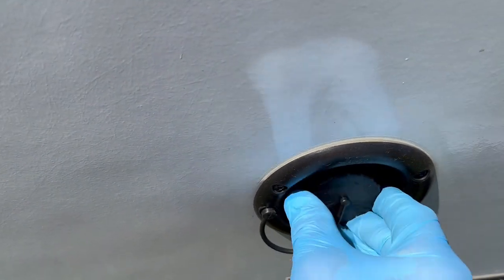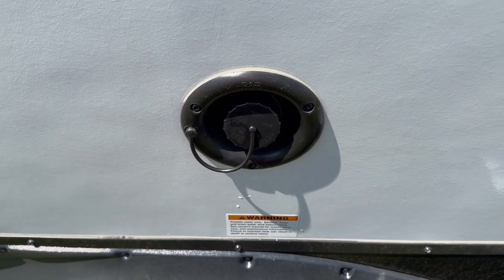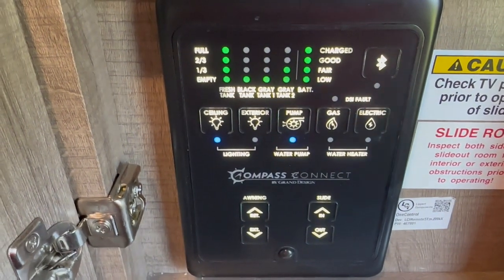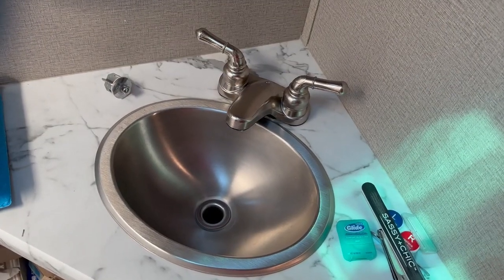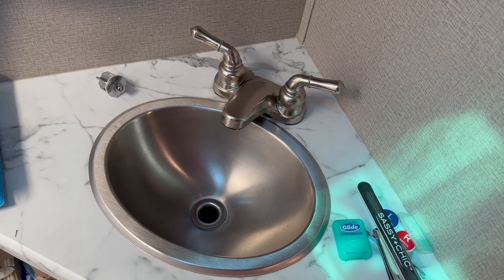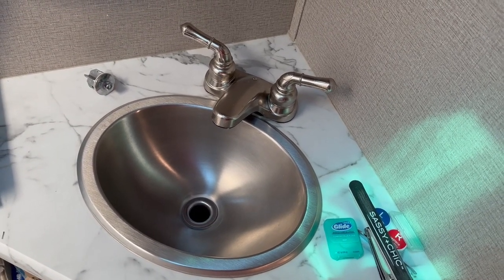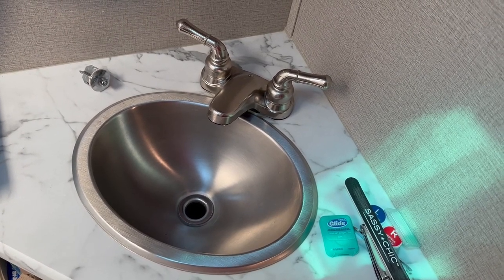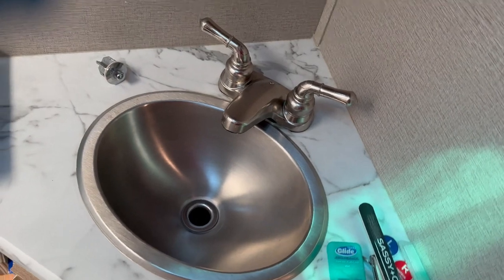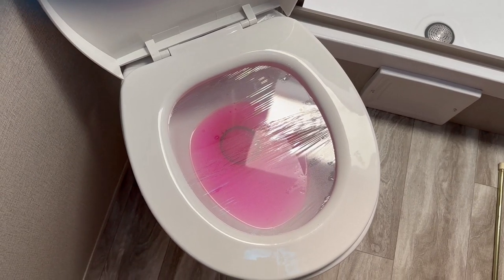One last step outside: put our cap back on and then go inside and start flushing the lines with that chlorinated water. First thing we want to do is make sure our water pump is on. Keep in mind that this RV was winterized and I haven't run any water through it, so we're not only going to turn on both hot and cold — there's no need to turn on your hot tank, and we bypassed that earlier — but we want to make sure all of our pink fluid is out and we're running clear water for a little bit.